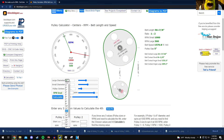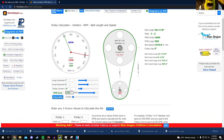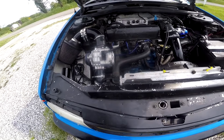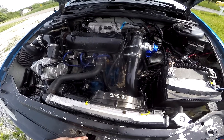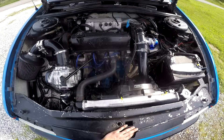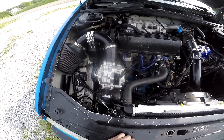The crank pulley is about seven inches, the supercharger pulley is about three inches, and it's spinning at about 14,000 RPM at the engine's redline. The supposed limit for these is around 16,000 RPM. I could make it spin faster by putting a smaller pulley on, however that would not make a big enough difference to actually make any boost.